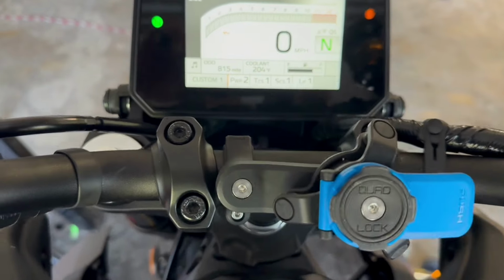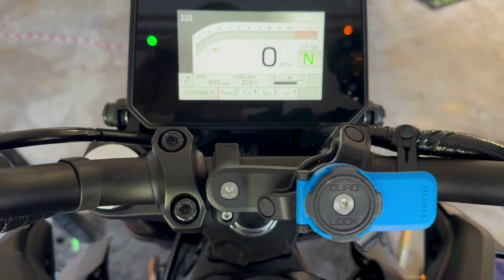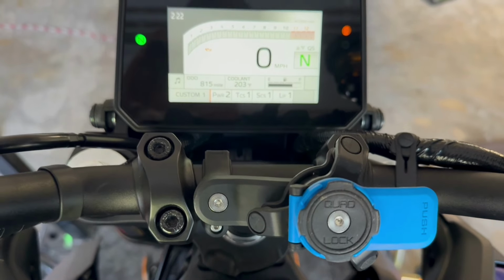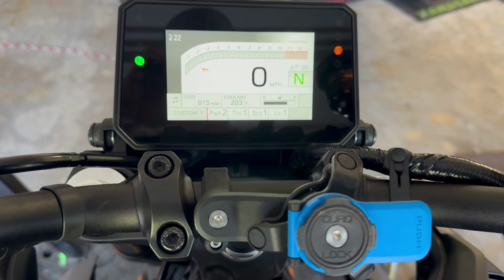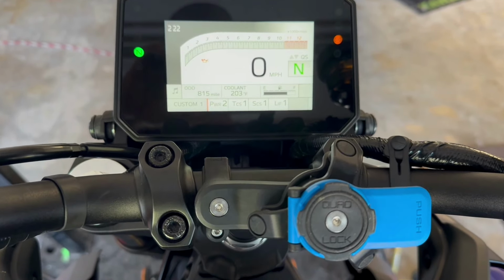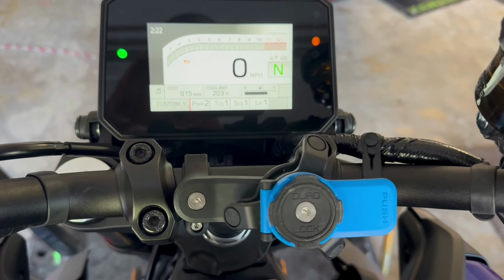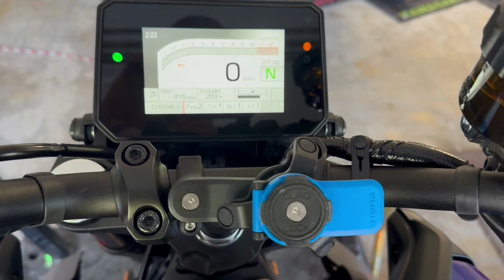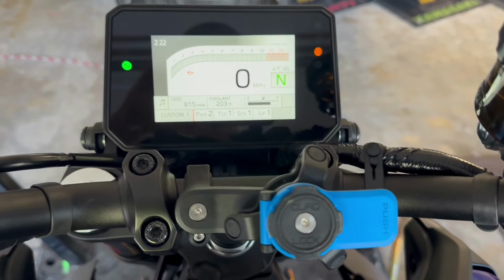The reason for that is because this is the first exhaust that I've tested on the new 24 MT09. It was made specifically for the 24 and not just the 21 through 23. The difference is it has two O2 sensor bungs in it, and that allowed me to hook up the stock O2 sensor and still data log it and ride it. Normally I can't do that. We could do it on the dyno because we could vacuum it out of the back of the exhaust, but